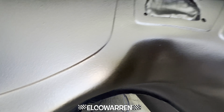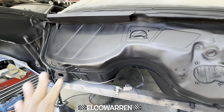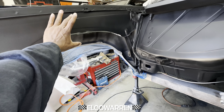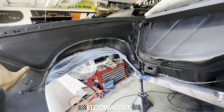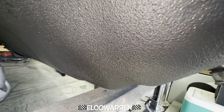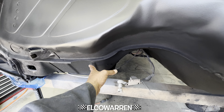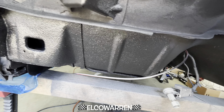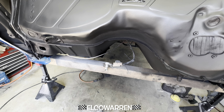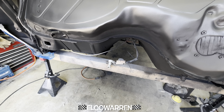I shot this out and my big homies that paint say make sure you reduce it when you go to spray the final primer. I might reduce it, but I like the orange peel, so I want to flatten this back out. This is already flat — I just need to hit it with 400, 600, 800 and we're golden.